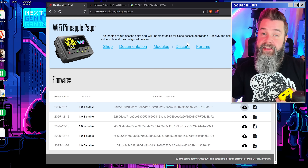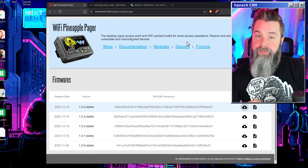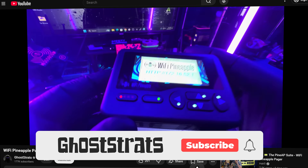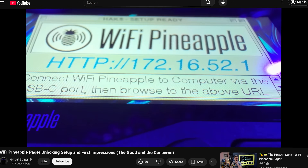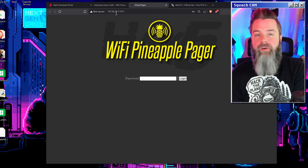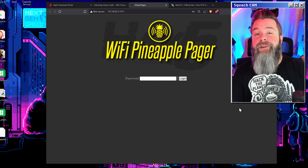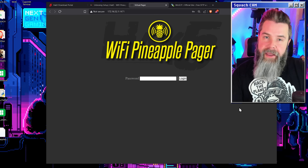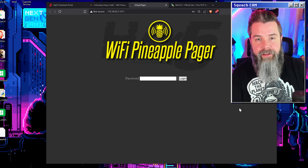You'll know your pager is done charging when the little light over the USB turns solid green — then you're good to go. For your first boot, hold the top button for five seconds and it's going to boot for the first time. That first boot takes a pretty long time, so be completely patient. In the meantime, take a USB-C cable that carries data, plug it into the pager, and plug it into your computer. When it's done, it's going to pop up with an IP address you can go to: http://172.16.52.1. Make sure you type that in manually — if you just type the IP address, your browser will do HTTPS, and because this is local we don't need the security layer and it won't work. Your page will allow you to select your firmware from the desktop and update the pager. It's super simple, takes a while, but we're almost there.